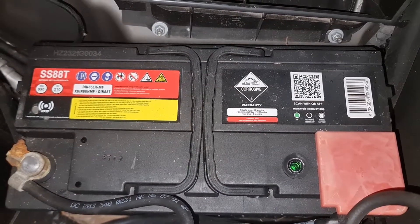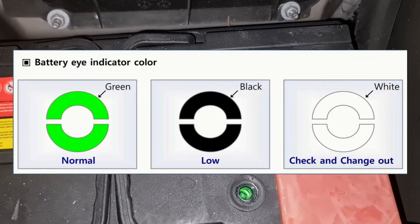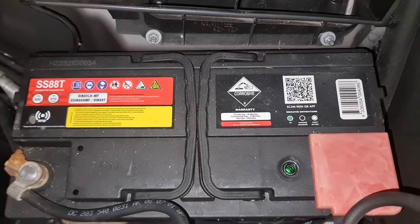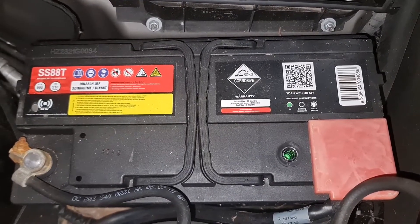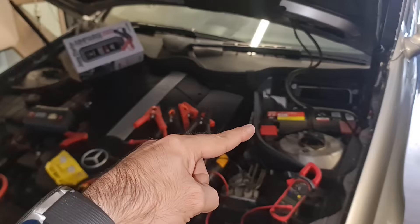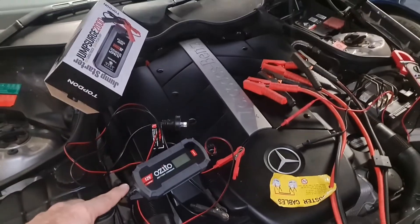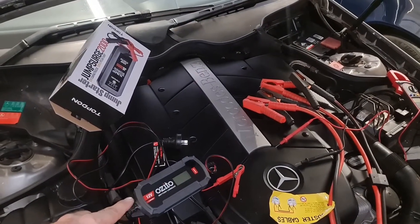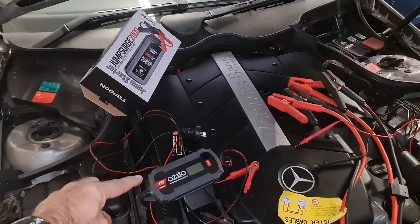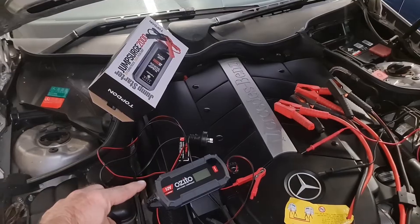What is the best method? If your battery is more than four to five years old and the indicator is showing white, you should replace your battery — that's the safest way to start your car without damaging expensive components. The second best method is using a trickle charger, though it may take eight to ten hours to fully charge a dead battery.